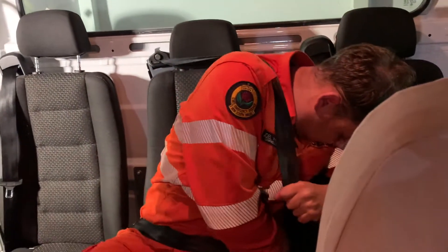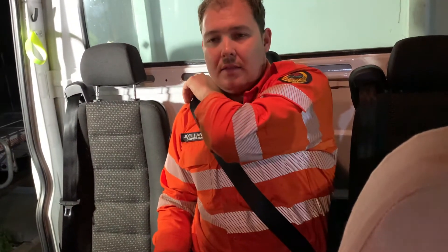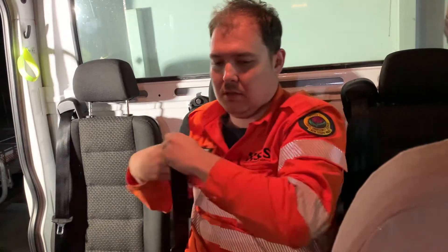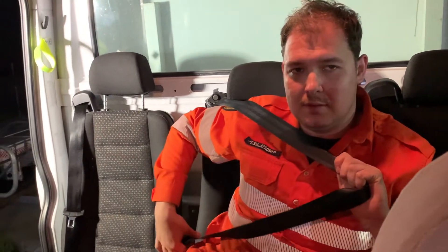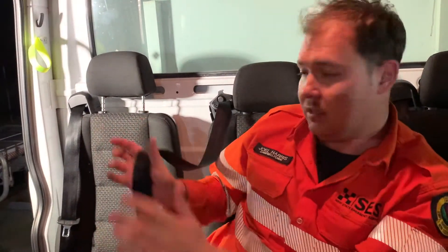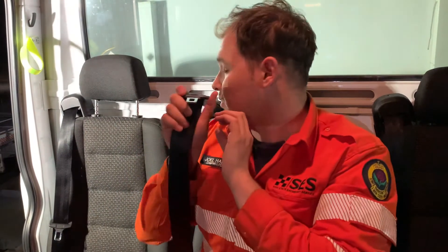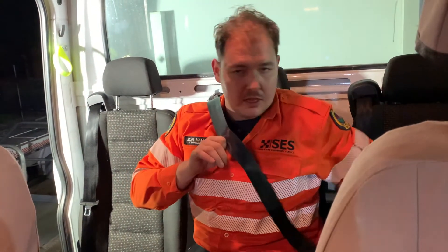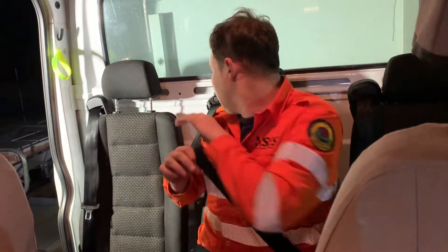The correct way to use the seat belt is to grab it and pull it out directly in front of you, buckle it in, and then feed what's left back in. The idea is you're not pulling it to the side. If you do pull it to the side, as you can see, it starts to jam up and goes limp — it won't retract. So gently pull it through until the sash becomes free, hold the seat belt whilst you click it in, and then carefully feed it back in gently.